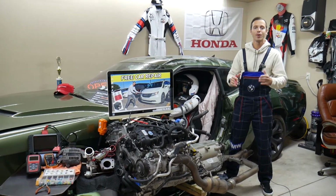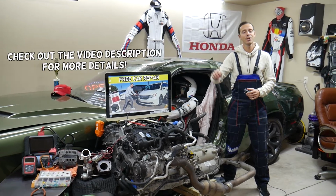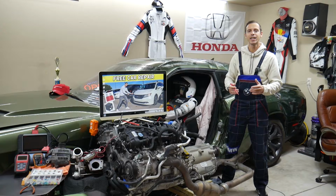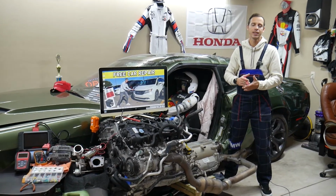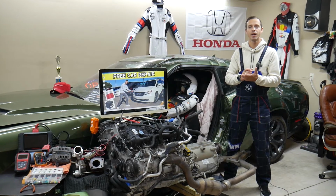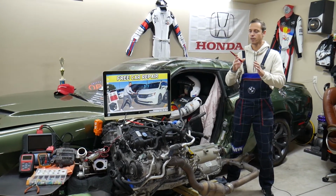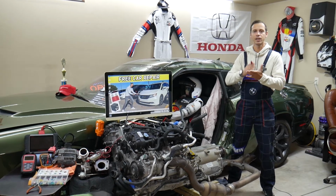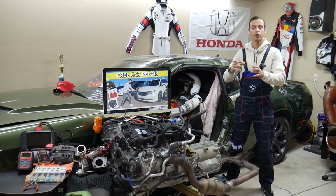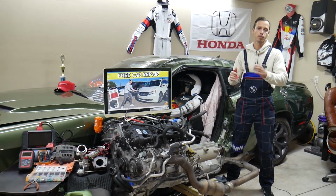Today will be a super helpful video for any of you having a Honda Odyssey of that generation, from year 2011 to year 2017. If you have one of those, you need to find the fuse for the ACM VCM system, guys. This is the fuse that controls the solenoids that eliminate the vibrations from the engine, because you have that active management on the engine that can cut the engine to work only on 3 cylinders, and that can create vibrations. So we have special solenoids to fix that, and that's the ACM VCM fuse responsible for that.